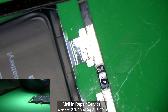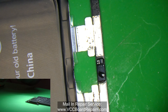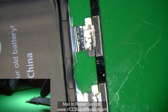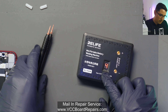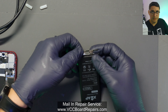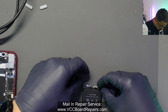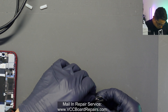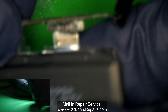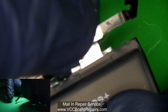Now we've got to pull this over just like the OEM so it can tuck back in. Let me think about how to do this. Turn this off — all right, it's off. Fold this as best you can if you want a tight fold. Let's go under the scope. You've got to fold these back down — I probably should have done this before. Like that, like how it originally was. There you go, got it folded in. Wiggle test — make sure it's not loose.